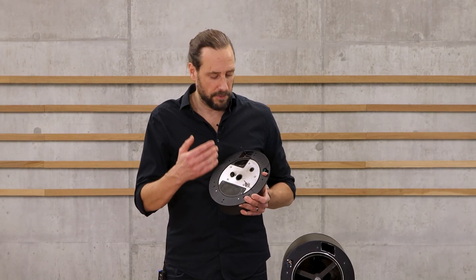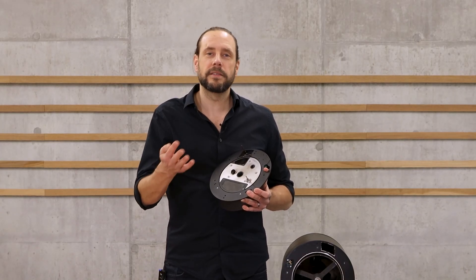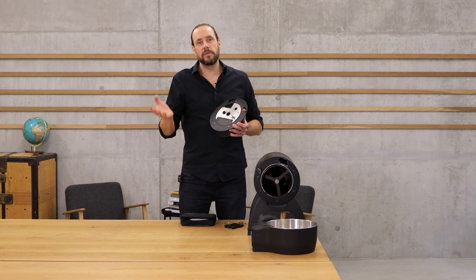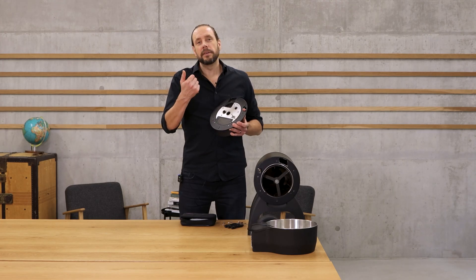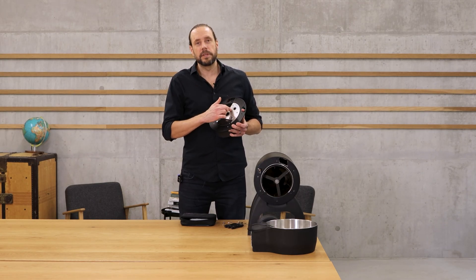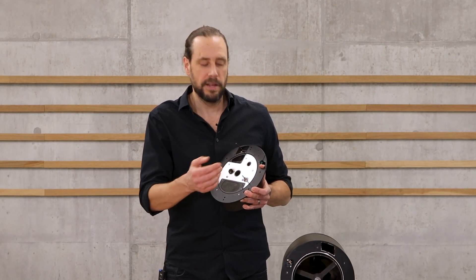In addition to that, iLeo built in quite an interesting new sensor — this one here. You can see it's an optical sensor called the IBTS, or infrared bean temperature sensor. As the name suggests, it measures the temperature in the machine with an infrared sensor. It has two functions: while preheating it measures the surface of the drum, so when you enter a preheating temperature you're entering a temperature of the drum's metal surface. Then when you're roasting, it measures the surface of the bean, which is a really fast and precise way of measuring temperature.